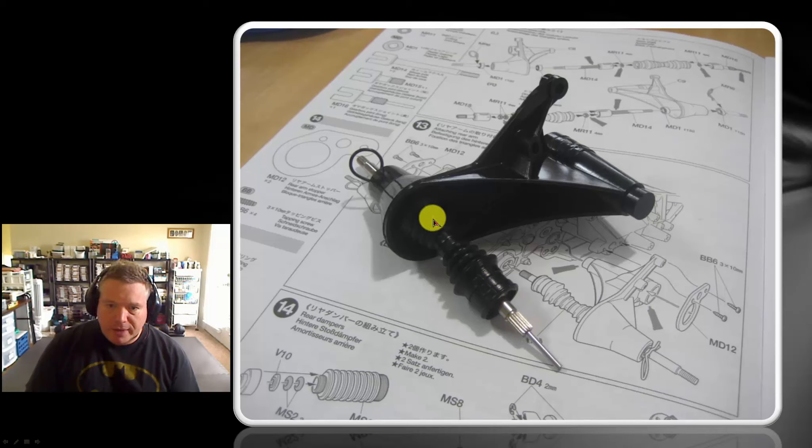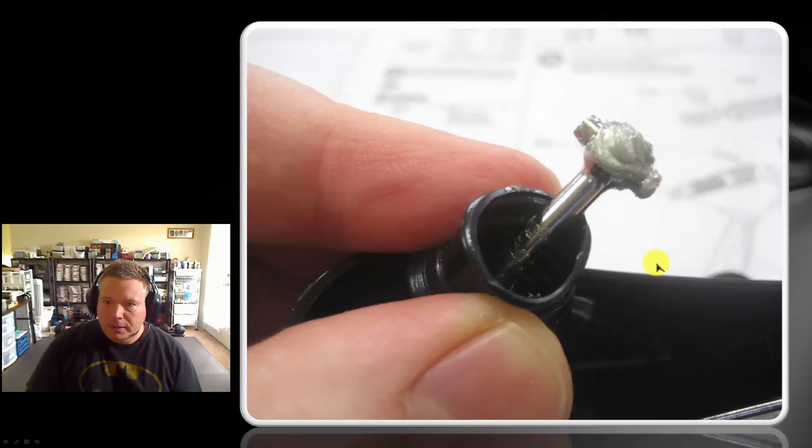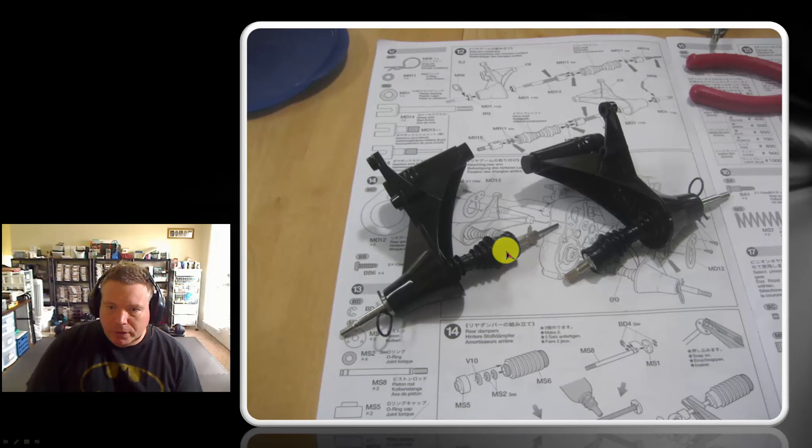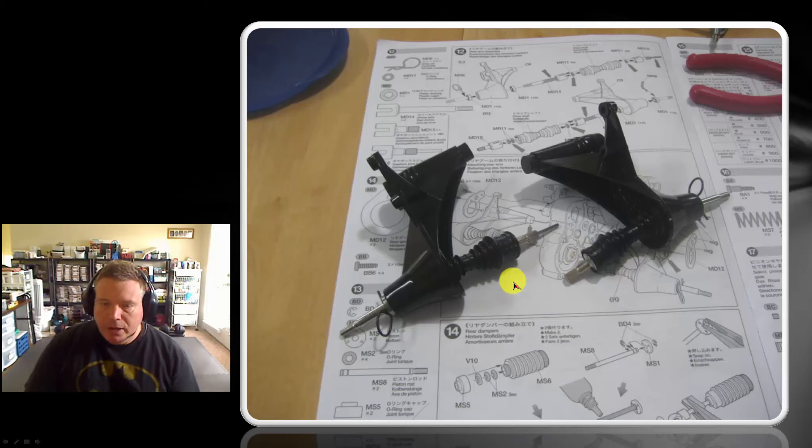From the end you can see there's a rubber O-ring down inside in a bed of white grease. The ball bearings are installed in the arm, then this thing slides through. I put this down inside, then put the shaft in to the end. This drive shaft is only in there by gravity right now, and the U-joints here and here are all just pushed in by gravity. I swabbed up the end with a good bit of that MW grease, then put the universal joint on the end and pulled the rubber boot right up to the edge. The one on the left side has the drive axle with the extended pin on it, and this one does not.